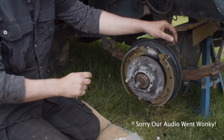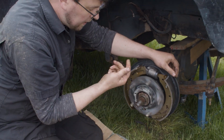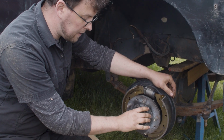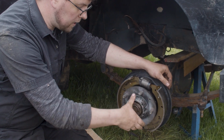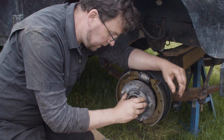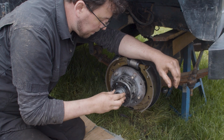So we had a bit of messing around to do to get that where it needs to be, but I have it now at the point where I have very little roller resistance, and I checked it and I have 2.5 thousandths end float, which is right in spec. It's right where the factory book says it should be. So last couple of bits now to go on.